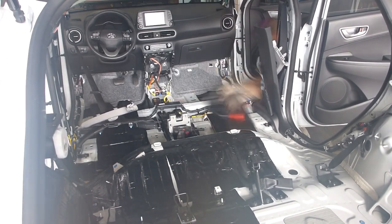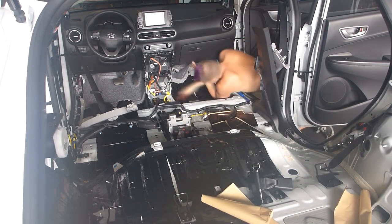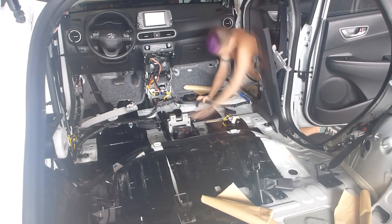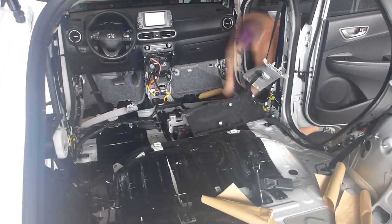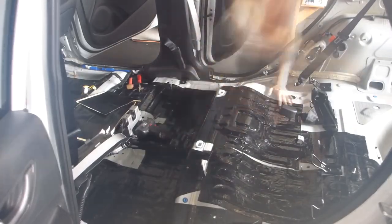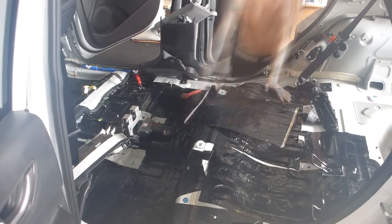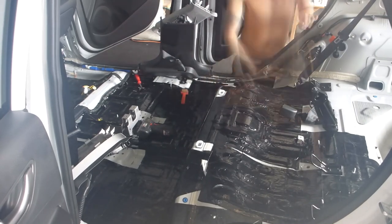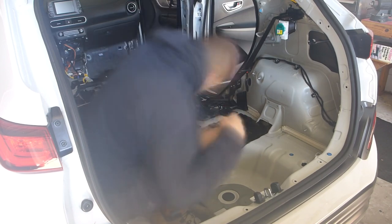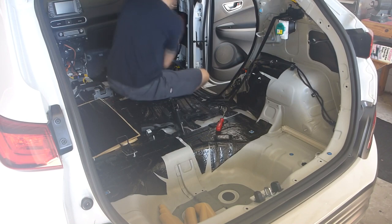What I really like about this video is that you get to see the insane amount of time it takes. Vehicle disassembly and reassembly makes up a really small portion of the labor ticket for a full vehicle sound deadening job. When I get these sheets they come in four square feet — I cut them into thirds, so what you're seeing me apply here, these rectangles, is actually a third of a sheet. I'll kind of size it up and cut it into place if I need to. I roll one direction with one hand, the opposite direction with that same hand, then I use my left hand and do the whole process again. Application is probably more important than the product itself. This product does not require cleaning the surface prior to application, however if it's a dirtier car I tend to at least vacuum the interior before I apply it — make sure there's nothing oily, dirty, or greasy that would prevent long-term adhesion. But this being only a two-year-old vehicle, the interior was totally clean.